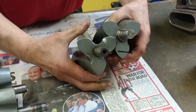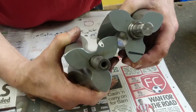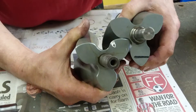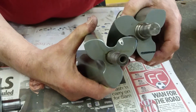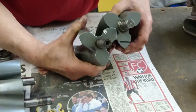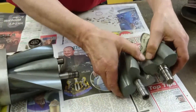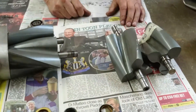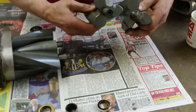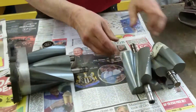To give you an idea of the tolerances we're talking here: in a normal running condition, these lobes and troughs miss each other by 0.2 of a millimetre — that's eight-thousandths of an inch in English — and that's as close as they get. When they get hot, they probably get even closer than that. So the degree of accuracy needed to retime these rotors so they're running with the correct clearance without any risk of touching each other is very, very high.